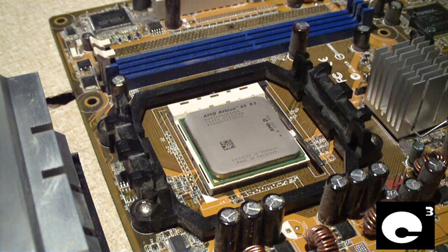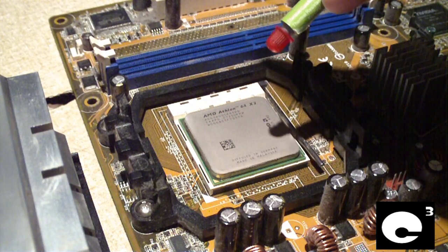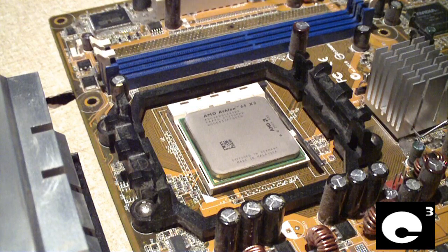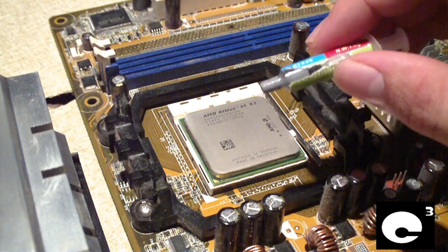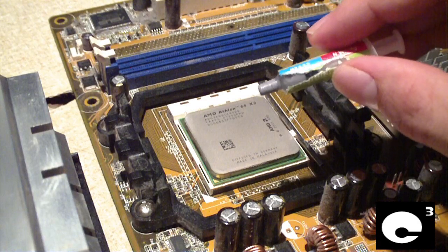There are several different ways to apply thermal paste. Some people put a big blob in the center and expect it to spread out evenly, but with Arctic Silver 5, which is very thick, it doesn't spread across the entire heat spreader and just compounds in the center. If you have thin thermal paste that flows easily, you might get by with a dot in the center. I'm using basic generic paste that comes with an IBM T60 cooling fan — I use this on basic setups. For extreme overclocking or pushing things hard, I use Arctic Silver 5.